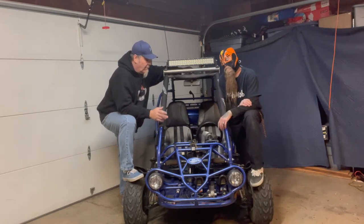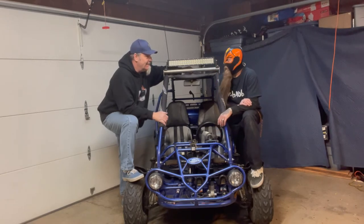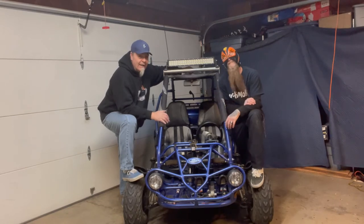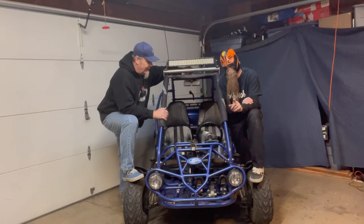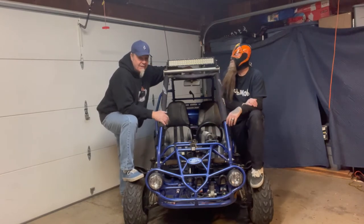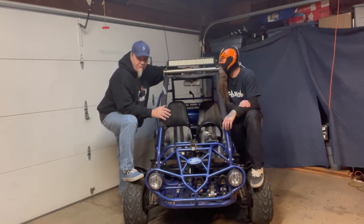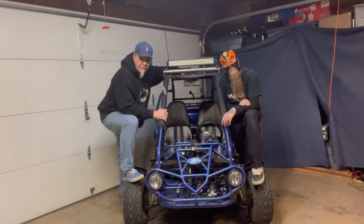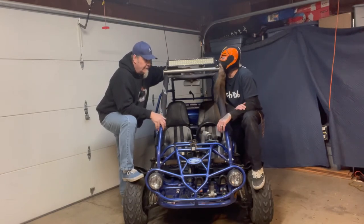So what we're going to do is, we talked about it off camera. We did? Yeah, I'm going to go ahead and get the performance CDI. Hey, it's your dime. Because that'll help the fuel problem. Yeah, well, no, it isn't going to help the fuel problem. So, we're going to pull the carb, we're going to switch up the jets next time, and we're going to put the performance CDI on there. That should make it run good. Now, hopefully, this solves the problem. If not, we'll address it. I don't know. If not, it needs a small block Chevy in it.